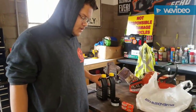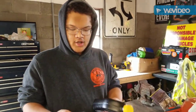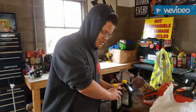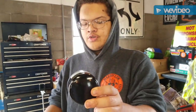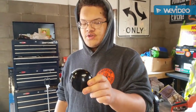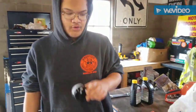New machine as of last year, so we are just doing routine maintenance. I have two quarts of Kawasaki oil — this is a Briggs engine on the mower, but it is basically the same stuff. Now with this oil filter, this is a short Briggs and Stratton oil filter. Since this was a brand new machine as of last year and obviously there is still a warranty on it, if you don't use the Briggs and Stratton oil filter and something goes wrong with your engine during the warranty, you are out of luck — it voids the warranty.